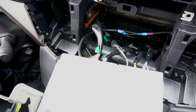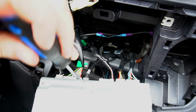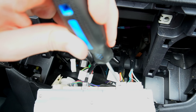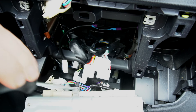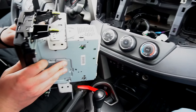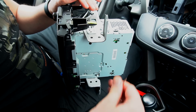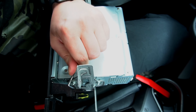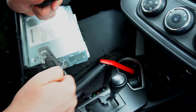At this point, we're going to take our flathead screwdriver and press on these clips to remove every single connection. The radio is now removed. The only thing you're going to need from the original radio are these yellow clips — there are four of them. We're going to use our hook tools to remove them, as they have teeth on both sides so you just have to pry and remove them. Be careful not to drop them anywhere — they have teeth on the inside, which is what holds them.